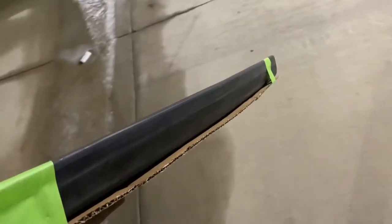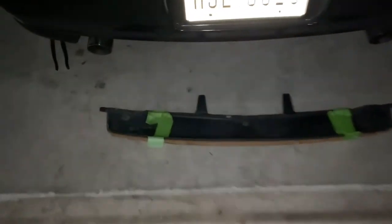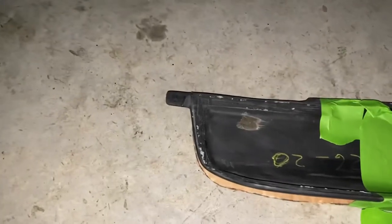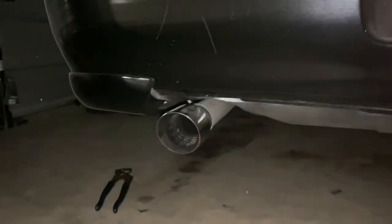Moving on, I made it to my storage garage and I got some advanced body fusion material which I used to chemically bond our experiment together so I could do a little test fit. Right away I ran into fitment issues with this piece since it was designed to be installed underneath the rear lips. These two mounting tabs on the outside wouldn't exactly let the piece line up and center.